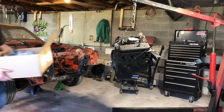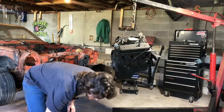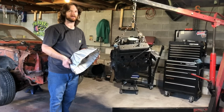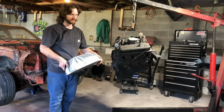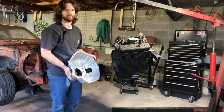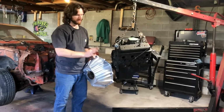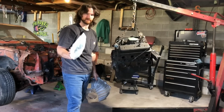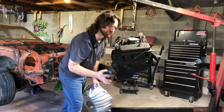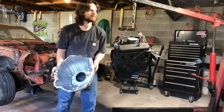So my fix for this is I picked up just a very common bell housing here. It can handle the bigger 168 and the smaller 153 tooth flywheel. They are very cheap because there are a lot of different brands that remanufacture them. This one here I got off of eBay. It was $80 roughly. Comes with the clutch fork, the pivot ball. It even has the fork boot and the dust shield. All I got to do is put it all together.